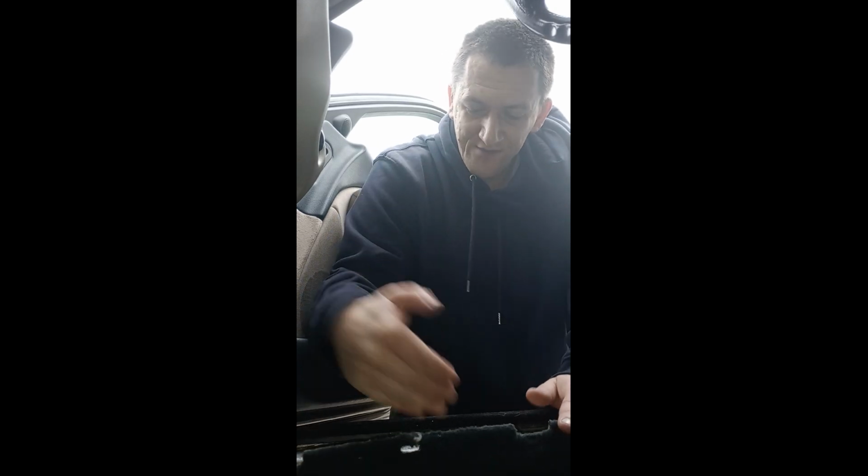You have got them. You've got one there, you've got one there. You basically just look out for them, put a hole into it. Just do what I've done. That'll actually coat the inside of all this section. You've coated the A post. Once you've done it from the inside, like I've just shown at the front, because you've just basically got the backside of the jack pad.